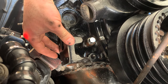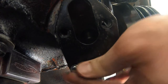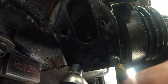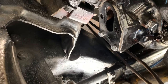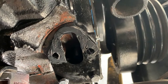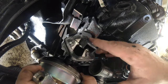I've got my bracket bolts in one hand, put the bracket on, screw in the bottom. I'm not going to fully tighten — just a little past hand tight here. Once the pump is on I'll tighten everything. We have the bracket in, the gasket in — you can see some of the silicone popping out there. The rod is still being held up by that bolt. Now we're going to put silicone on the bracket part, then the gasket, more silicone, and then the fuel pump. Tighten up those bolts, swap some bolts around, and we're done.